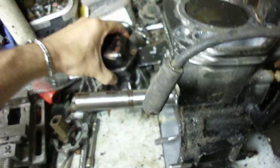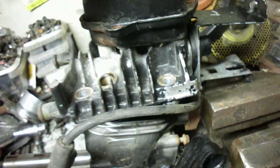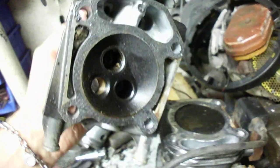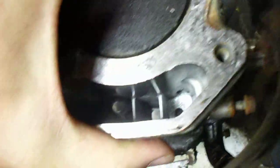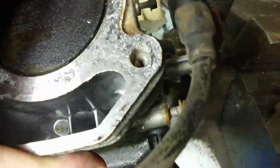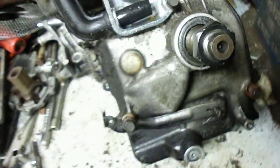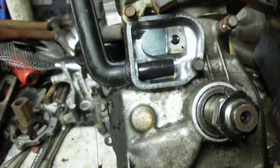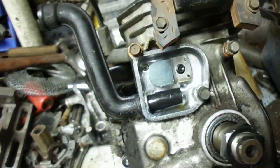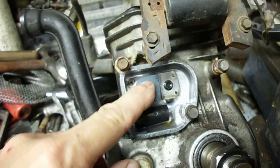When you tip it up, the high point is actually the top of your cylinder head way up here, and I really have to question how much oil is going to get up there when you run it that way. You also get the problem of oil getting splashed up from the crankcase into there, and then there's a pocket that it has trouble draining back down from — so it fills up and then spews out the pipe.